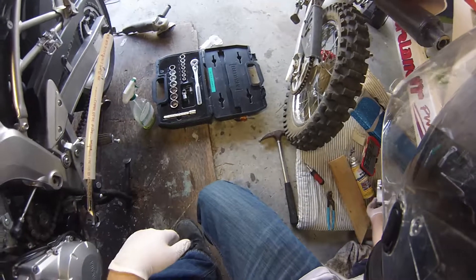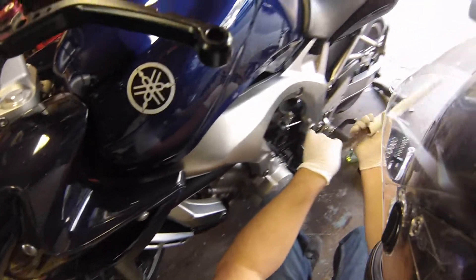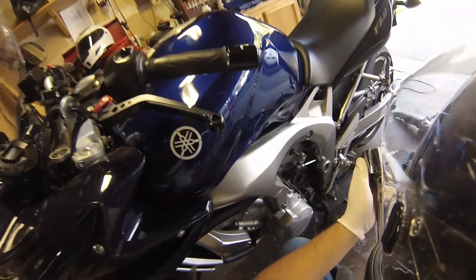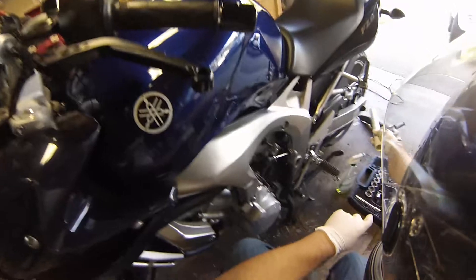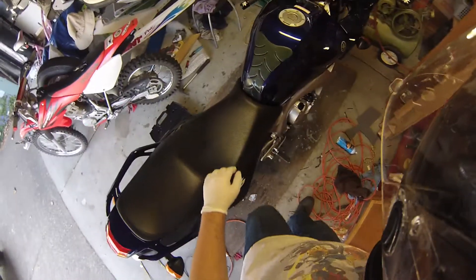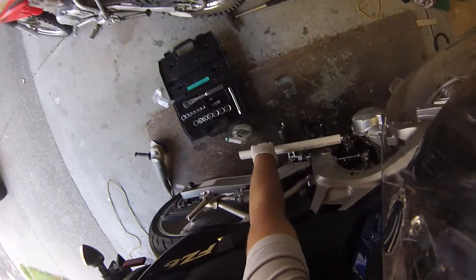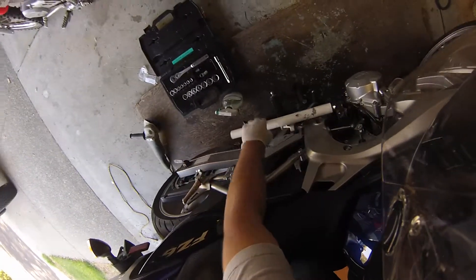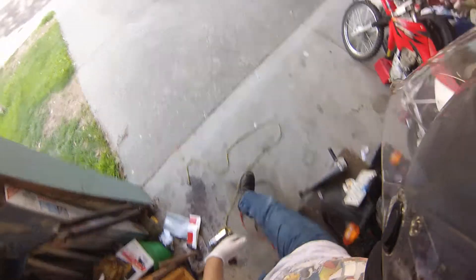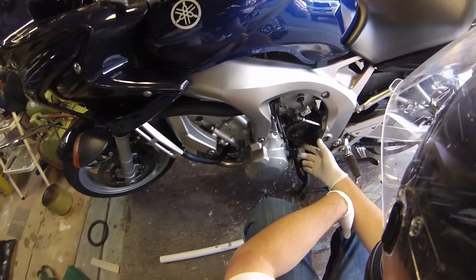You're going to need to remove this nut right here, which I've already done — that's why it can spin. The way I did that: I used a breaker bar with a 32-millimeter socket, the same as the one needed for the rear wheel. I put that on, walked around to the other side — the bike's in first gear — and I put all my weight on the rear brake, stood up, put my knee up, grabbed the bar and pushed and pulled. It took a bit of force and it popped loose. You don't need any help — just do it yourself if you've got a center stand. I'm going to leave the nut on here until I actually plan on replacing it so I won't lose it or the washer.